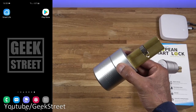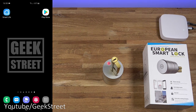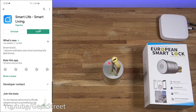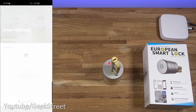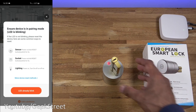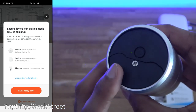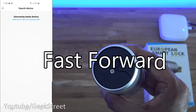Now let's make a start setting up this device. I've set up my Zigbee gateway - I'll include links in the description below. Coming to my Android phone, the app we're after is Smart Life - if you search for that, that's the one you're after, either that or Tuya. When using this for the first time you'll be asked for login credentials, so register an account if you haven't got one. Clicking on my studio room, you can see the smart gateway is set up, but there are no devices added in there yet. To get this added in, click on add sub-device and ensure the device is blinking in the background. On the lock there's a button - hold on to that for about 10 seconds until you see a light flashing.